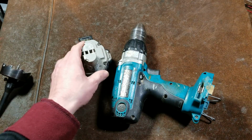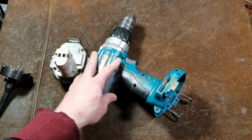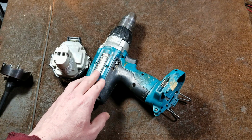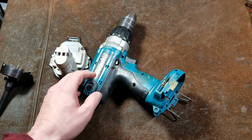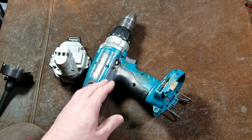So as far as the power demonstrations, I'm not going to buy a battery to do that. But I've got basically a bunch of my power supplies all hooked together to give me about 14.1 volts and about 30 amps of output, and I'm going to go ahead and solder some 10 gauge wire to this and then give it a test.